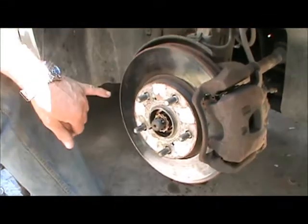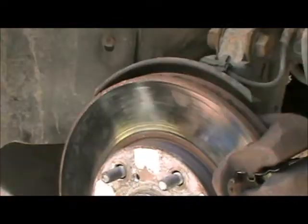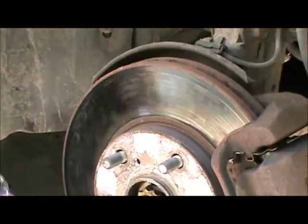If you turn your focus onto this front brake — we've got the wheel off obviously — can you see the kind of splotches all the way around the brake rotor? These are what are often referred to as hot spots. It's caused by overheating. Certain parts of the metal get hardened, and the metal around it wears a little faster, so you end up with little bumps all over the rotor, which is what you're feeling when you're coming off the highway.